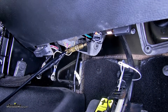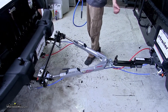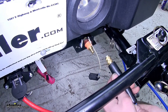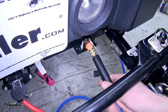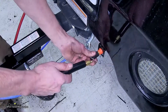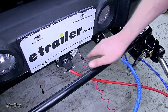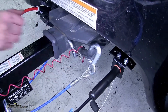There are two things we need to do outside of the car. We're hooked up like normal to our motorhome using our tow bar and electrical connections. Now we need to hook up our airline and our breakaway cable. We'll remove our dust cap on the fittings — we have a female end that goes to our male end. We'll slide the cover over to help protect it from the elements, route it over our tow bar, remove the cover from our motorhome, and install the fitting. Then slide the cover over that, and ensure that our cable from our breakaway switch is attached to a secure point on our motorhome.